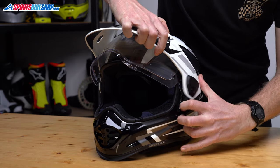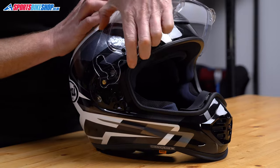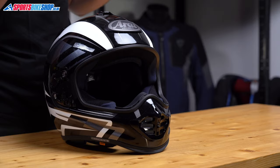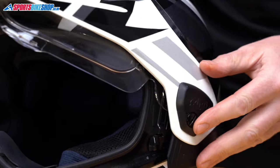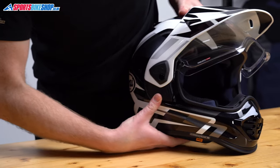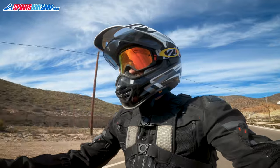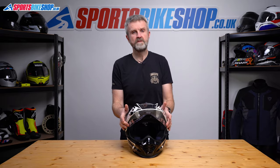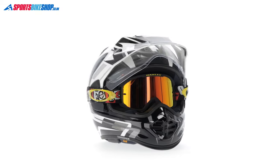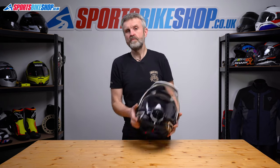It's far easier to change the visor on the TX5 than on the TX4. You don't have to unscrew the peak — you just release the side pods with two buttons, leaving the peak attached to those side pods. Once you've changed the visor, you reattach the side pods. That's much easier than before with much less chance of losing small parts, which was an issue with the TX4. For goggle use, goggles will go in with the visor lifted; I rode on dirt like that with no difficulty. You can also remove the visor completely, refit the side pods with just the peak, and goggles will fit inside very neatly.